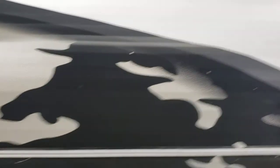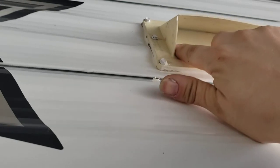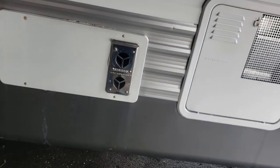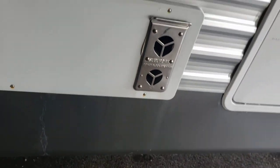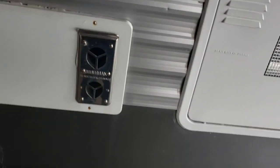Vent for your range hood — if you're cooking on your range and you want your fan running, open that up. That'll allow the flap to swing freely. Once these are open and the fan's running, it'll push the flap out of the way, allowing the gases somewhere to go. Furnace — the only thing you folks will have to do is keep it clean. They make screens you can put on it; they don't recommend running it with the screens on, but for storage and travel it's good to keep debris out.